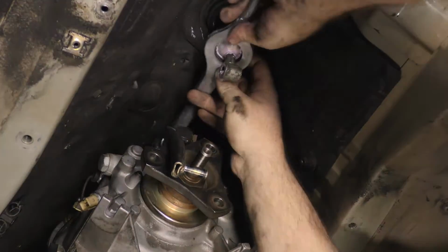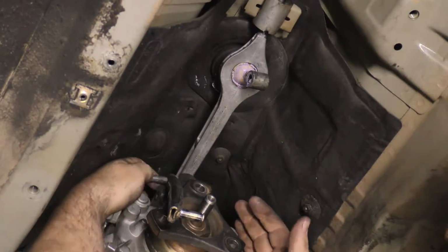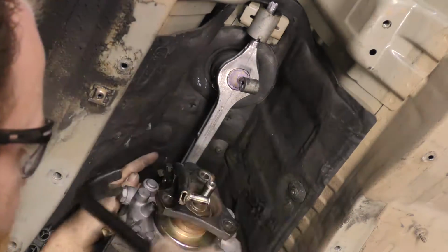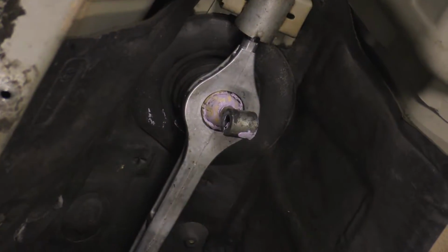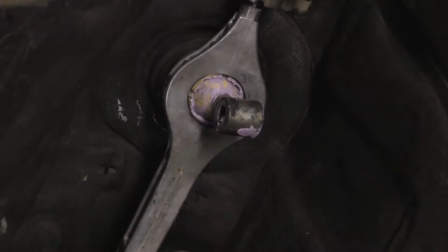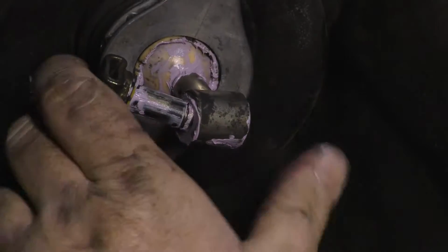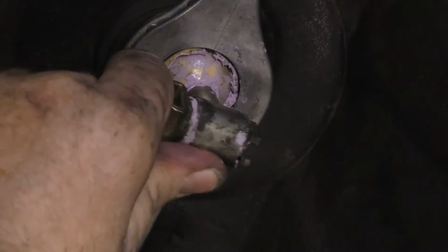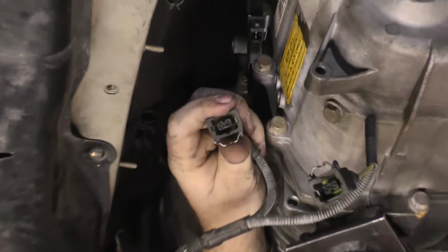Place the shift arm into position. If it was completely removed, connect it to the shift lever first and then place the front into the transmission. Install the clip pin and secure it. Lube the gear selector rod and place it into the shift lever. Install the washer and secure it with the retaining clip. At the driver's side rear upper portion of the transmission, connect the electrical plugs for the sensors.